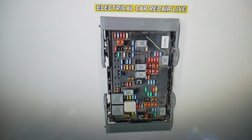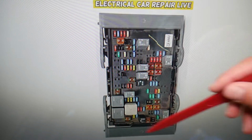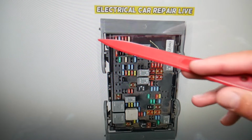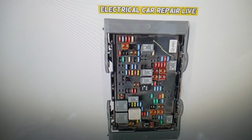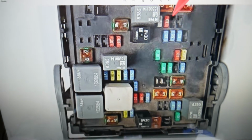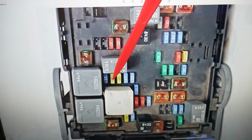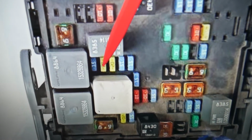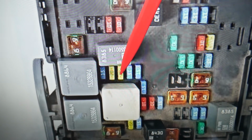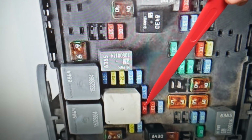For the headlights, 4 different fuses will need to be checked. If you look at that fuse box layout, this is towards the front of your Chevy Silverado, windshield side, passenger side, driver side. If we zoom in a little bit here, the first fuse that we need to check, for low beams, is fuse number 11, that 20 amp fuse. Then you need to check fuse number 16 right here. Then for the high beams you need to check fuse number 30 and fuse number 32.